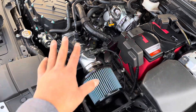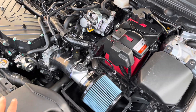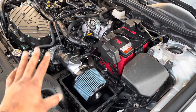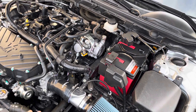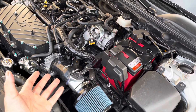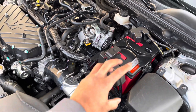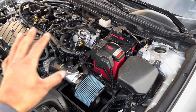With turbos it's going to be completely different from NA, and the same thing with superchargers — completely different from NA. Because of how this turbocharger works, it doesn't work like a typical turbocharger. These engines are very complex, but the lower you can get the intake air temperatures, the better the ignition timing is going to be. The turbo cars run off boost pressure. Anytime something heats up there's going to be more pressure, so if you can keep intake temperatures low and pressure low through the whole system, a cool 18 pounds of boost is going to be more effective than a hot 18 pounds of boost.